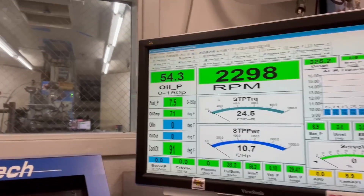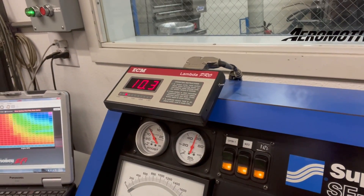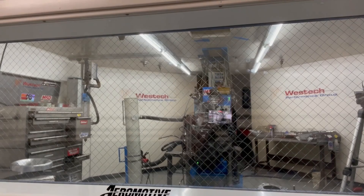We've got a carburetor on the M90, fuel lines hooked up — let's fill it with fuel and see if it starts. We've got our fuel pump at 7 psi going to the Holley. Give a couple of pumps, fingers crossed. It's alive! Still on the rich side, but she's a runner — carburetor up and running. Now let's see if it makes power!